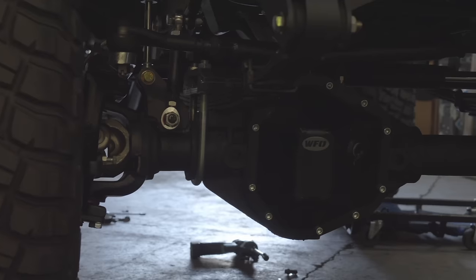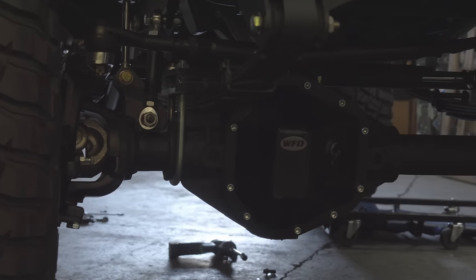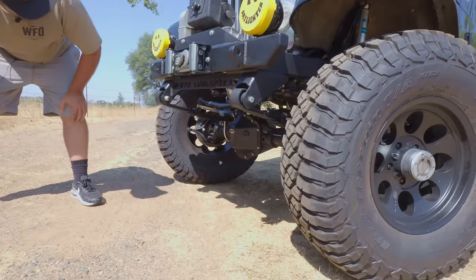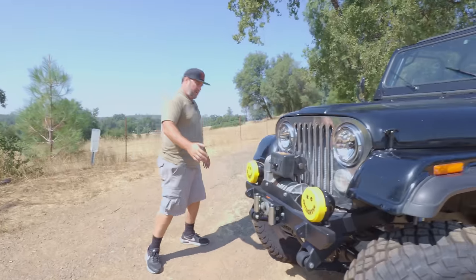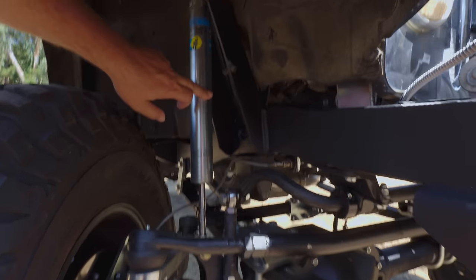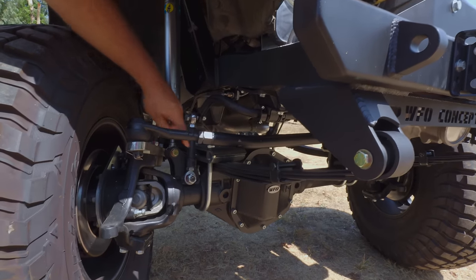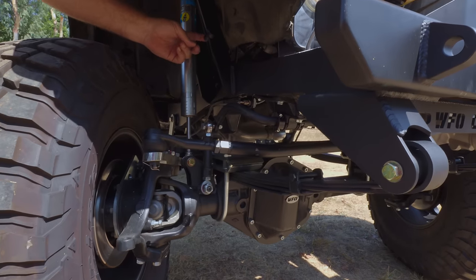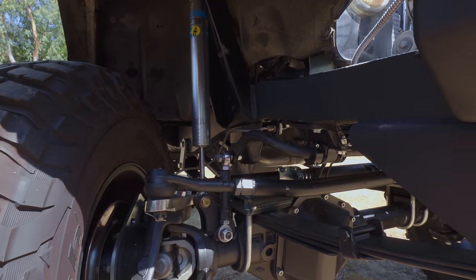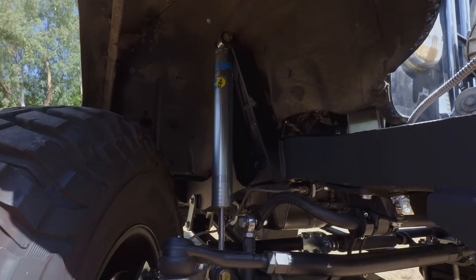We always like to do one-tons — get it over with, don't worry about breaking axles. Starting in the front: Dana 60 kingpin front end, narrowed to 63 inches wide. Chrome-Moly axles, 35-spline outers, ARBs front and rear, 5:13 gears. The only way to go on the CJ is our double arms — kingpin double arms, one-ton Chevy tie rod ends. You can see the Bilstein shocks, the sway bar hooked back up with factory sway bar heim joints. To disconnect it on the trail, you loosen the bolt, swing the sway bar link, and slide it right onto the stud on the shock tower. Bump stops, frame plates, shackle reversal, and prototype CJ shock towers — 12-inch travel shocks in the front, nine-inch in the rear.